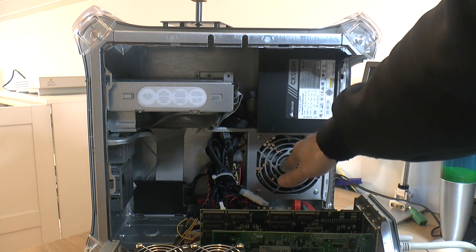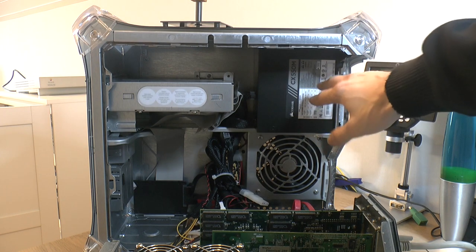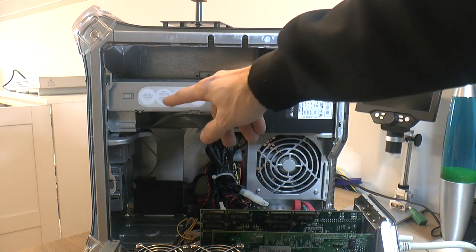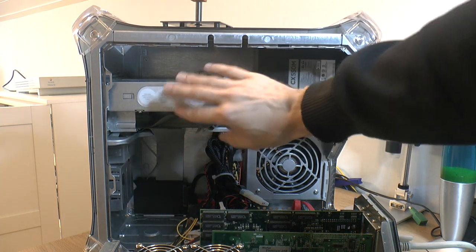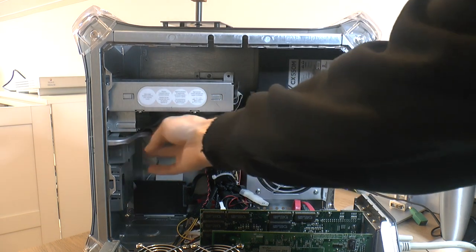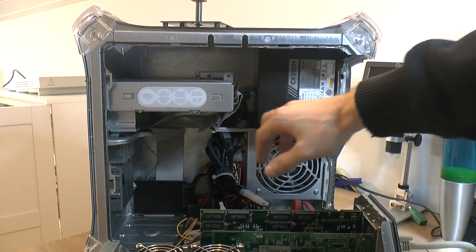And this works as an exhaust, and so does the new power supply, which is a Corsair CX550M. The reason why I picked that is because it lines up with the rear holes here. And also, like I said, I shaved off the CPU cooler so it passes here. Also, this holder here for the front base is actually from a Quicksilver case. This is not the one from the Sawtooth case. Also this piece that goes here, and this fan holder, is from the Quicksilver, and that's just to make more room for the bigger CPU cooler.